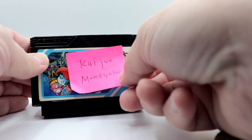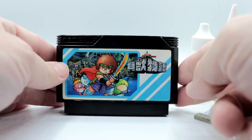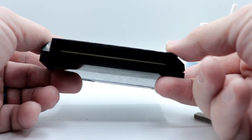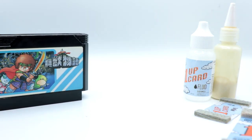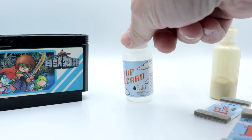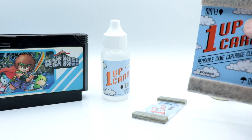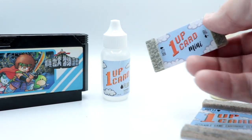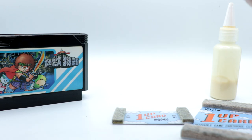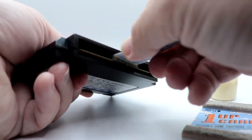Taking a look here — this is Kaiju Monogatari. I love the looks of Famicom cartridges; the artwork looks sharp and pretty. Looking inside though, I can't really get a good look at the pins. So what we're going to do is what we do with all cartridge-based games we get from anywhere. I have One-Up cleaning card fluid here — basically just isopropyl alcohol. I've got two different cleaning cards: a larger one that works great on NES, Genesis, and Super NES cartridges, and for Famicom cartridges, the One-Up card mini tends to work well — it's designed for Game Boy, Game Boy Advance, and Game Boy Color. I'm going to put a little bit of fluid on the fluid side and scrub that.